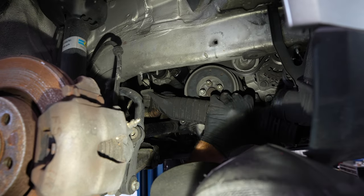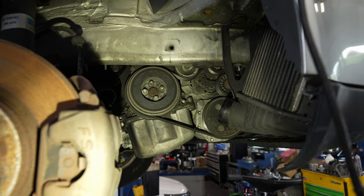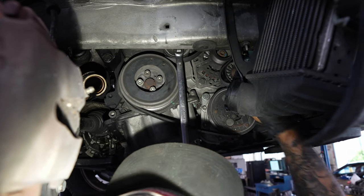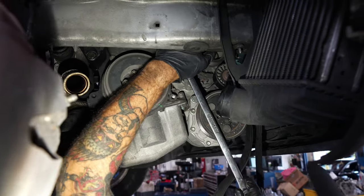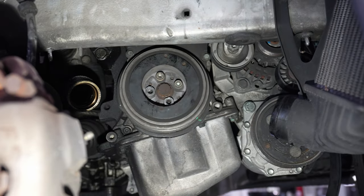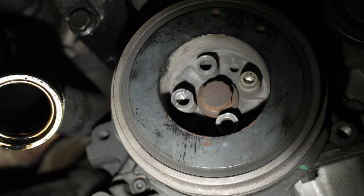Quick release here. Let's get the belt off for now. The six-bolts are stripped — looks like four different ones. Two are stripped pretty good. The balancer is cracked — not good — we have to replace the balancer. Cracked right there at the left bolt hole.